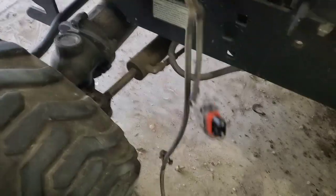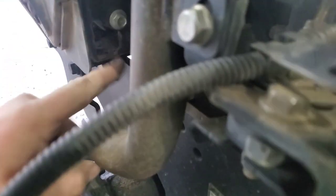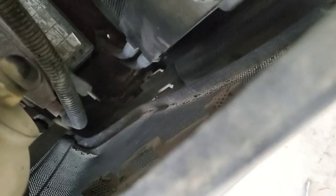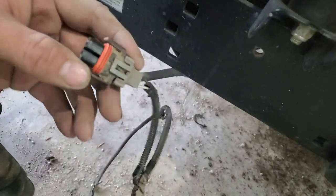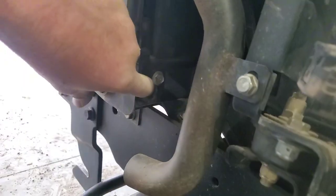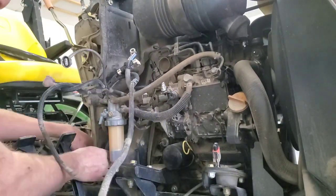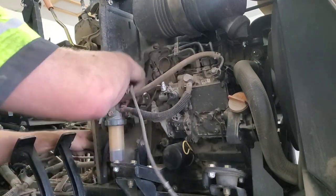There's a little bit of a trick to getting the headlight harness part out. If you undo the starter and pull the power cable up through here like this, it gives you plenty of room to pull the connectors out in one piece through this little cavity right here. We're taking the harness and slipping it through from the engine side back into the driver compartment side. It's a little bit of a trick to get in there, but just take your time pulling it through.